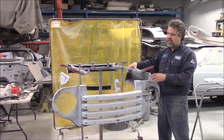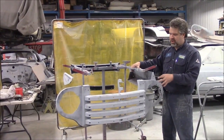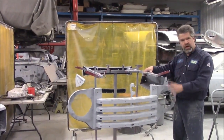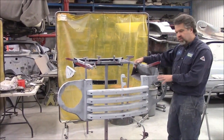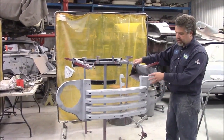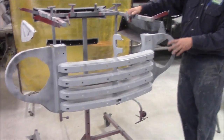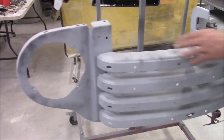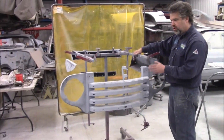When this Ford truck came to us, someone had painted all the components black — different shades of black, believe it or not — with a lot of runs in the paint, and it was new paint product over top of a bunch of old product. So what we've done is sandblasted all of the metal components to bare metal. We've applied a two-part black epoxy to seal all of the steel, and then we're in the process right now where you can see we have sprayed it with a grey high-build primer. This little bit of black shading you see is what they refer to as guide coat, which helps us when we're block sanding to show any flaws or imperfections in the components.